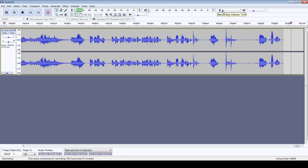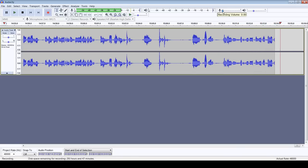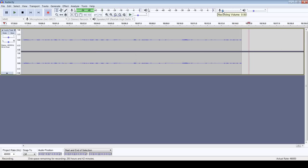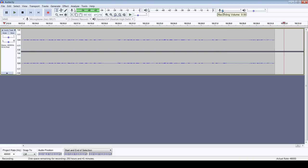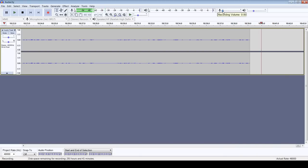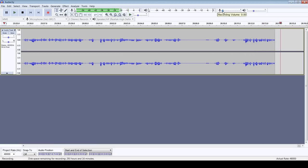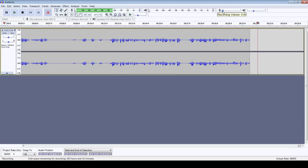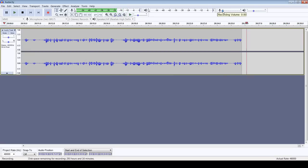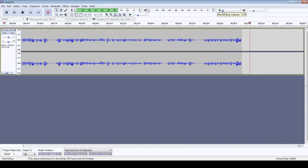Let me go ahead and switch to the dynamic mic, starting off with the quarter-inch jack. I've switched over to the Pyle PD-Mic 58, and as you can see, when you're using the quarter-inch jack, you can't hear jack. I did have to bury the needle just to get something out of this. If I use input 3 and 4 as opposed to input 2, it shouldn't be as hissy when you max it out, though it will come in at about the same volume level. Now that I've got the proper XLR cable plugged into the PD-Mic 58, it probably sounds a whole heck of a lot better. Yes, I'm still burying the needle so that you can hear me, but the fact that the mic is louder and richer means you're probably not noticing the hissing anywhere near as much. And if I told you that this mic only costs $14, you might be a bit surprised.